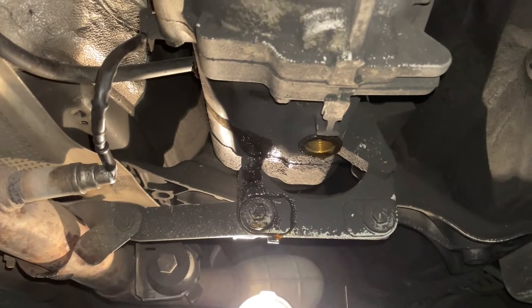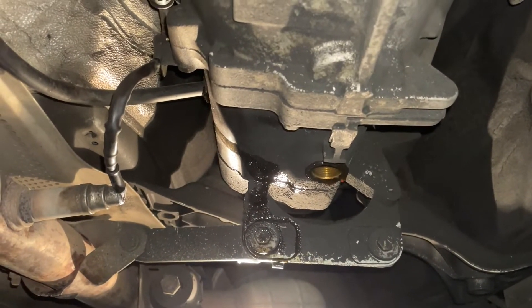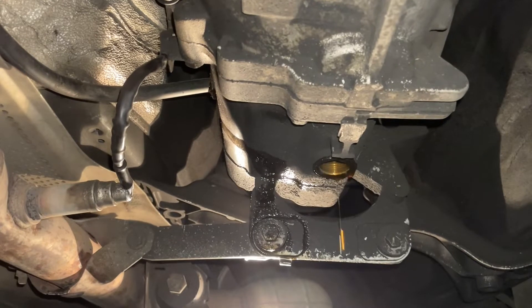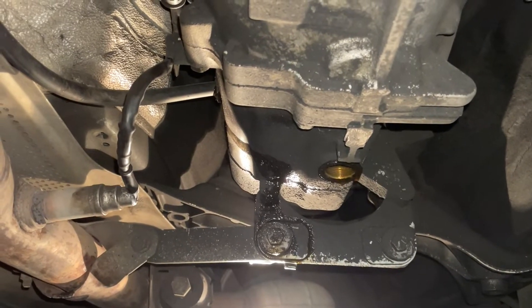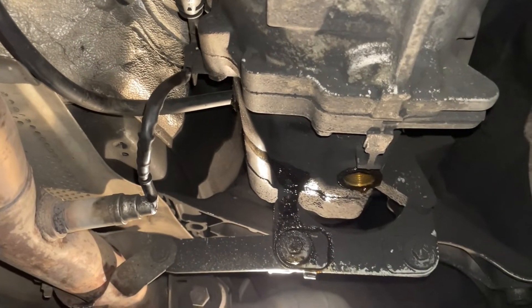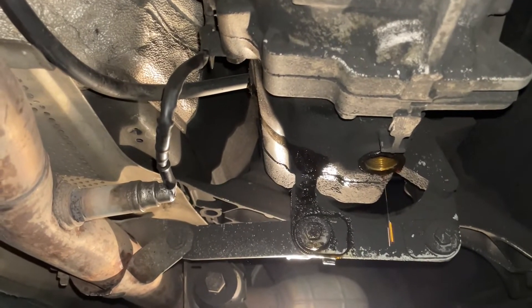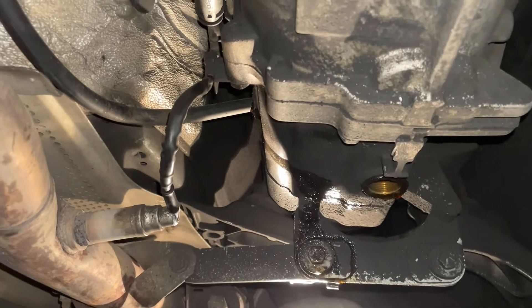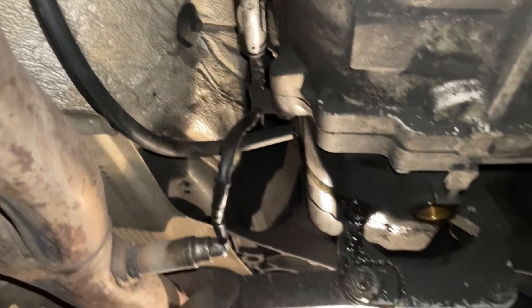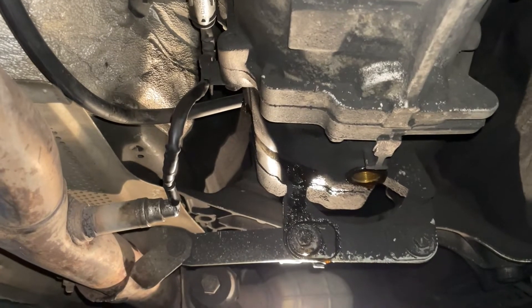I got the drain plug out. Most of it's already drained, but I'm gonna let it sit here and drip for a minute to make sure I got all the fluid out, then I'll put the plug back in and start funneling it in. Both plugs are 17s. You will have a little difficulty trying to get these plugs out — mainly the fill plug. The drain plug is no problem if you have a ratchet and an extension, but the one on the side next to the transmission tunnel has a lot of clearance issues. That may be a bit of a struggle, but other than that it's a super easy job.